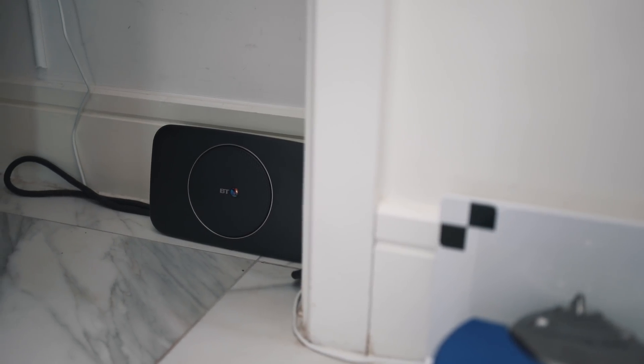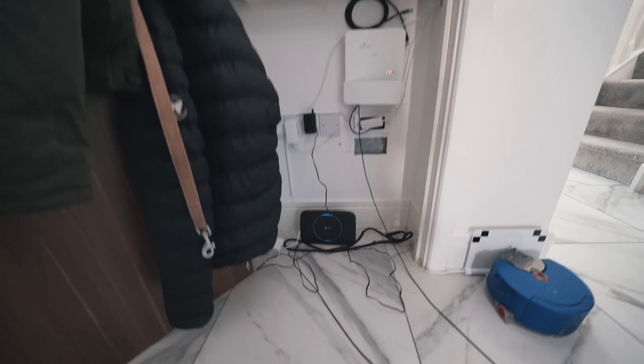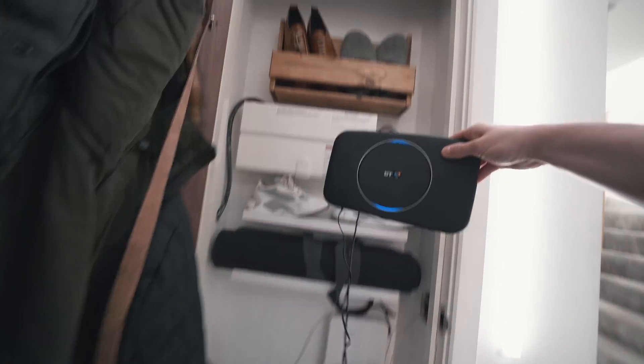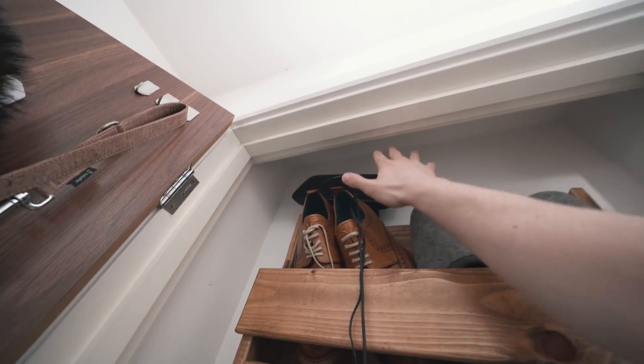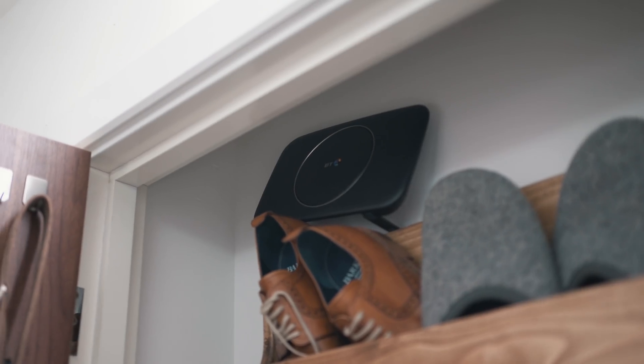There are two things you can do here. The first is router positioning. The second is adding access points, which is where you'll need to spend some money. We just got a result of 51.6 meg with the router sitting on the floor in the comms cupboard where the internet comes into the house. Simply what I'm going to do is take this and move it up here — and by moving the BT router just a couple of metres off the floor to somewhere a little higher up, I guarantee that will completely change the game. Let's see what we get now. We're back up — 240, 250 meg. I would be happy with that, and all we've done is move the access point off the floor. Wi-Fi falls like anything would with gravity, so the higher up you can get your access points, the better. But if you're still struggling, you need to add some access points.